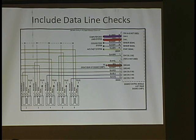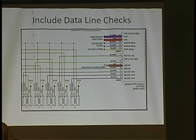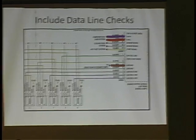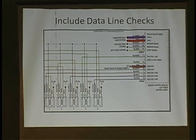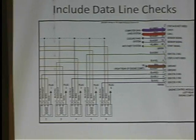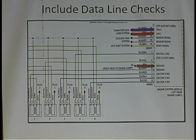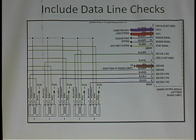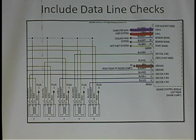I went over all the wiring and everything seemed fine. He said, yeah, I checked everything too. I couldn't find the ignition feed — I looked at every single pin and just didn't see it. I couldn't reason with it. So I said maybe the processor is bad, because I came in for a second opinion. The ECM was like $1,200, so we went to carpart.com to get a used one. We put it in — and that wasn't it.